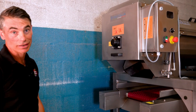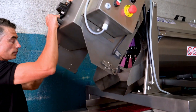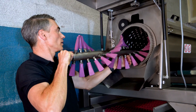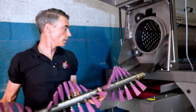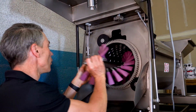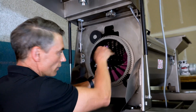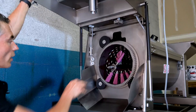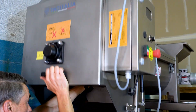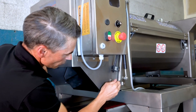Now we're going to take the destimming bar out of the Jolly 60 Reverse for cleaning. We unlatch the back cover and lift up the unit — it's important to lift it all the way up so that the shocks engage and it stays open. Then we slide out the destimming bar from the receiving receptacle on the other end, and you can rinse all this out as well as the basket. To put it back in, insert it here, line it up on the other end by pushing down on this side so that side goes in parallel, then slide it back into the machine. Line up the destimming bar, close the hatch, and line up the two pins with the slot in the receptacle, then push into place and lock the hatch.